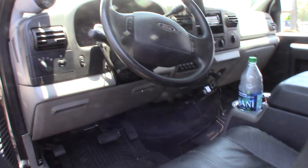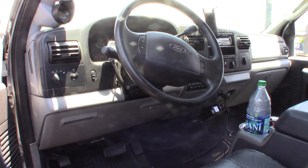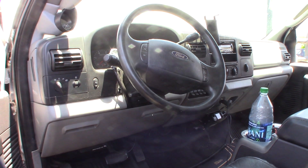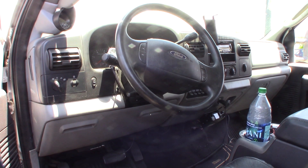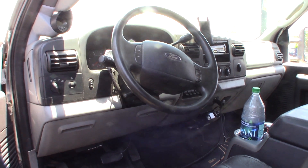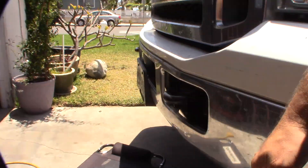So this is my car straight right now and you can see that it's not straight on the wheel. So there's two different ways I could fix this. I could take the steering wheel off and just straighten it with a steering wheel puller, but an easier way on this truck is that it has an adjustable drag link.